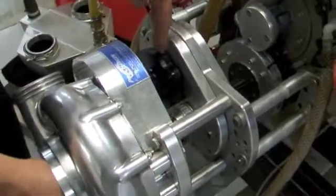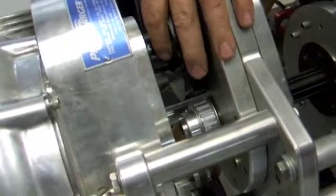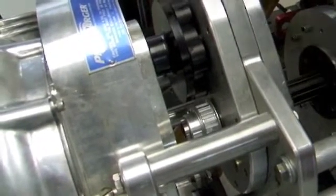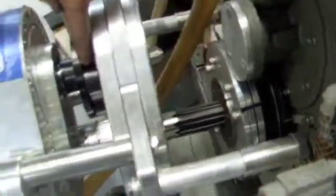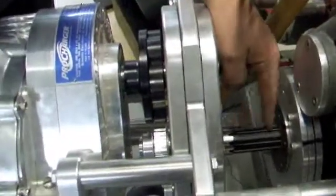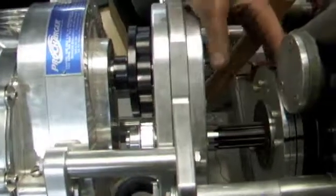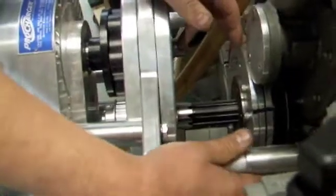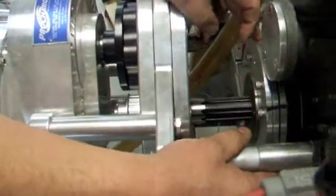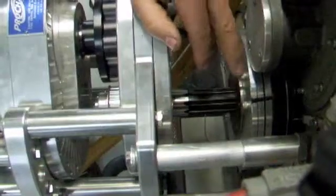What we're doing is we are eliminating the drive bushings. We're still using the bushings on the blower side — these don't seem to get hit when you take care of all the harmonics at the crankshaft. We're replacing the coupling that comes with the gear drive with our own 10-spline 4130 shaft, and we build this whole torsional vibration coupling. It has 400 pounds of spring pressure in a torsional dampening.